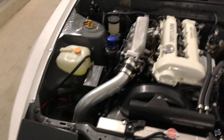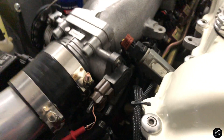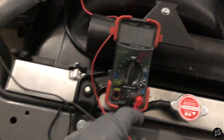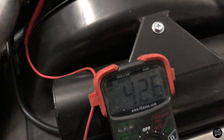For how tight things are in my car, I have to use this little wrench to get to the flathead screws. For your case with an SR it would be a seven millimeter which is easier. The screws are already loosened. Turn the key to the on position. Our pin is securely fastened in there, red lead is in there, set to 12 volts — and we're reading 0.426. That's pretty good; I want to be at 0.45.